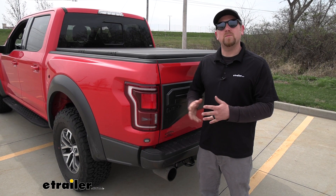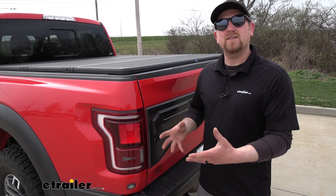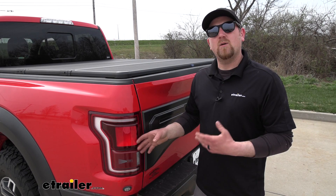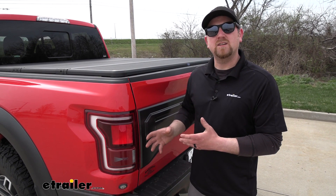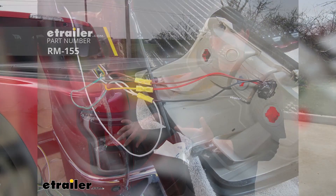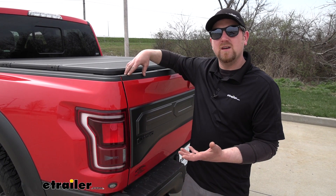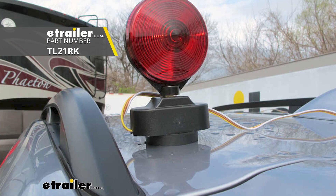The whole purpose of the diode wiring is to transfer the lighting signals from the back of your motorhome to the back of your truck, keeping you safe and legal. It provides all the necessary lighting functions — turn signals, running lights, and brake lights. The diode wiring is really our only feasible option here because bulb and socket cannot be installed in these taillights — there's just not enough room. Magnetic lighting is also not an option because it's tough to find a spot on the back of the truck, and a lot of Fords are aluminum, and magnets will not stick to aluminum. In my opinion, the diode wiring is the best choice anyway.